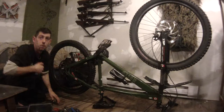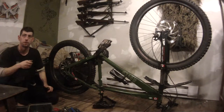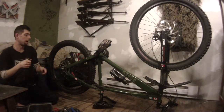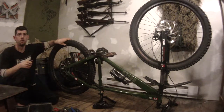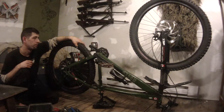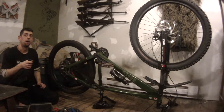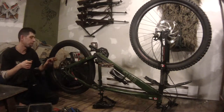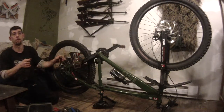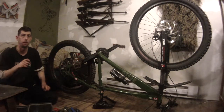V brakes are a lot easier to work on — they're just a cable and you set them up. Cantilever, same thing — any kind of rim brakes are just easier to work on and cheaper. If you're a beginner rider and you're not sponsored and you don't want expensive maintenance, just go with rim brakes. Stay away from these discs — they're just a pain. Like they're very effective — I can stop with a pinky — and I have a damaged left hand so discs are good for me.